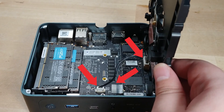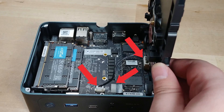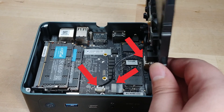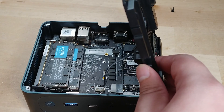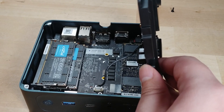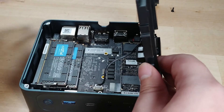There are essentially three cables attached to this shroud: the power cable for the fan, the power cable for the actual power plug, and a smaller ribbon cable that goes to the NVMe, which actually routes underneath the already pre-installed SSD. It feels really bad to try to open this thing up, and even worse when you're trying to disconnect anything.